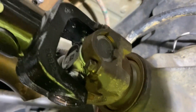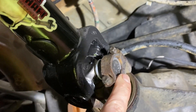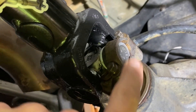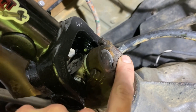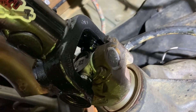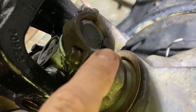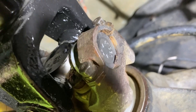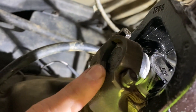It's really pretty difficult to mess up a driveshaft install. The one thing you want to look for is that little notch in the yoke — the U-joint needs to be seated and held inside that notch. That's what it's there for: to retain the caps. This U-joint has two caps, and if they come off your bearings are all exposed. As long as it's seated in there on both sides you're good to go. You can see that side — spin around and see this side also seated in the little groove.